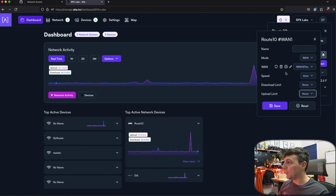According to Alta Labs, if you completely fill all of the ports with other devices, non-PoE devices, by the way, it will still idle around 9 watts, which I'm inclined to believe based off of it only using 6.6 watts. However, if you plug PoE devices into those same ports, of course you're going to use more power. And speaking of which, it only has a total power budget of 40 watts, which is pretty healthy given the size of the device. Right now, I have the Alta Labs local controller plugged into it, and we're using about 11.4 watts with everything sitting idle. I have both of the devices quite literally stacked on top of each other here. I know that's hard to see, but that is what you are looking at.